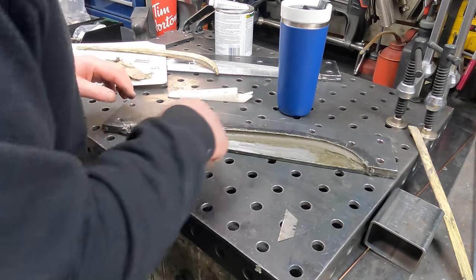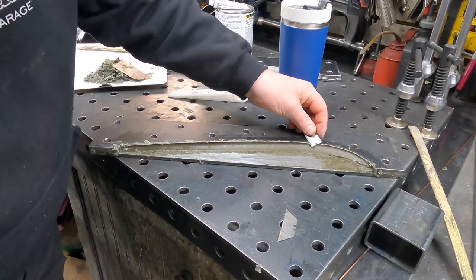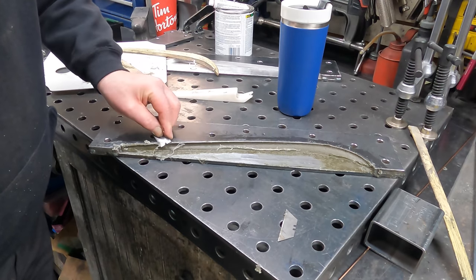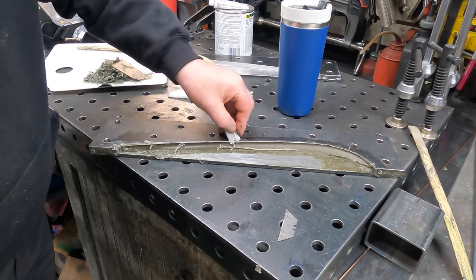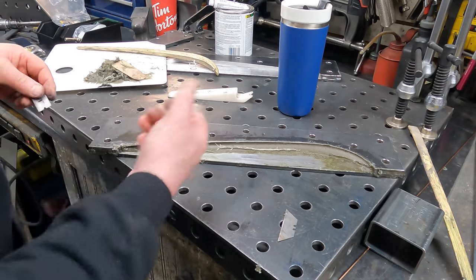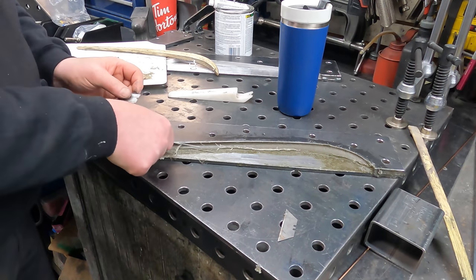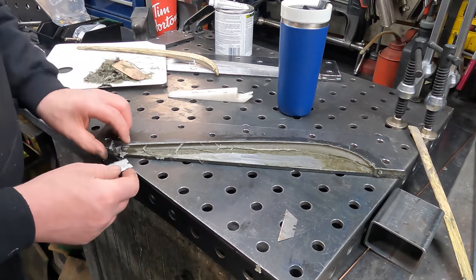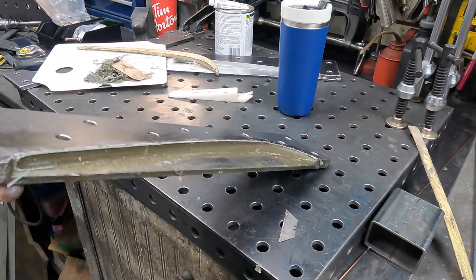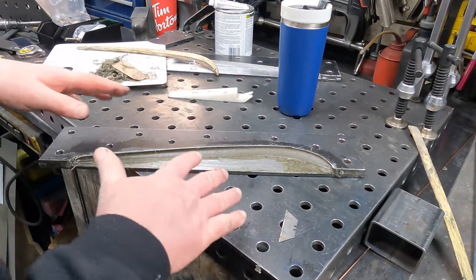Once it's cleaned up there are bound to be the odd issue — I was having some trouble with the back corner. Some of this can be done right now while it's easy: just use the top line, slide the razor blade over into it, and trim it out. We also want to make sure that none of the angles are going to lock. Once it's fully cured it gets quite hard, so we'll come in with a little bit of short strand filler just to smooth it out. Pretty happy with that — we'll take it. One down, let's clean it up and do the other half.